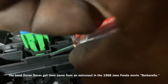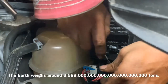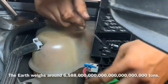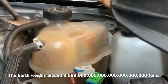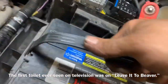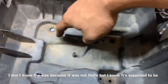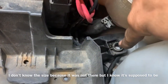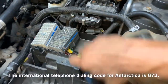Push down on them and push them away — hard to do with the camera in my way. Taking the computer and setting it off to the side, we can remove the battery cover and disconnect the positive terminal of the battery. With our battery disconnected, we need to undo one 13 millimeter nut stud for the positive. With that undone, we can flip the fuse box over and push our tabs to release the last two connectors that hold our fuse box to the subframe. Then we're going to remove four 13 millimeter bolts that hold down the battery tray and one 10 millimeter bolt on the back side.